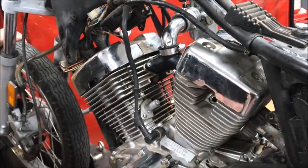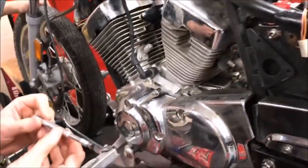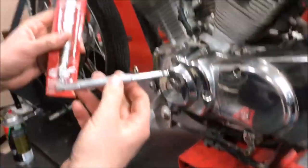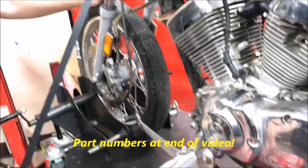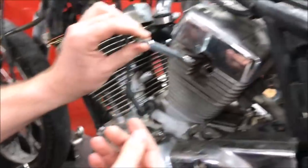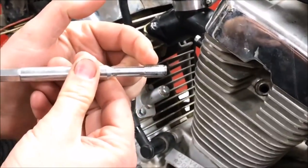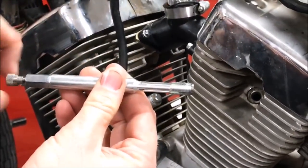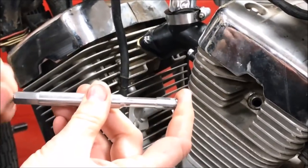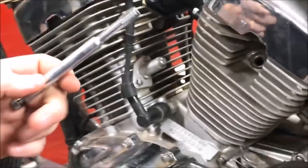So we don't want to make it worse. I'm going to show you a tool — these are called back taps. This is a Napa one. What's so cool about this is I'm going to pop this down in there and then pull it back into the proper shape. I can put however much tension I want, so I can actually do it kind of light the first time and take a light pass. Love these things.